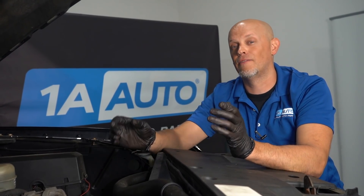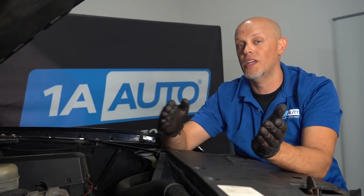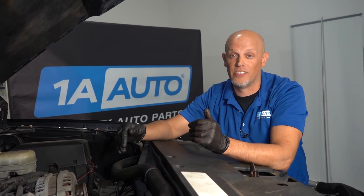Some of the reasons why I don't wanna continue driving the vehicle if the serpentine belt broke — the first is safety. If your power steering is gone, it's extremely hard to turn certain vehicles, so you wanna pull over as soon as possible. The next would be the alternator or the charging system. It's not gonna be working properly. You'll see a little battery light on, and your engine's just running off what's left in the battery. That may go on for another five or ten minutes — you don't know. But at any time your engine could just shut off, and if you're in the middle of an intersection that's gonna be bad. The last, which could cause probably the most damage, is the water pump. If the water pump's not pumping coolant through the engine, the engine's gonna overheat and could cause some serious damage.